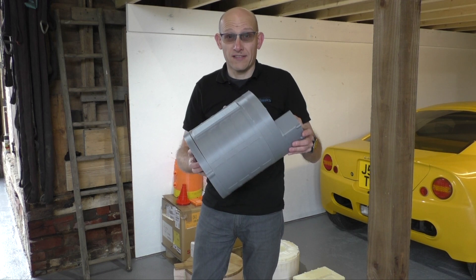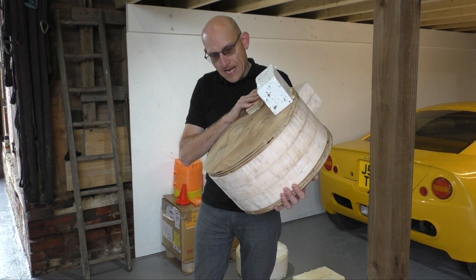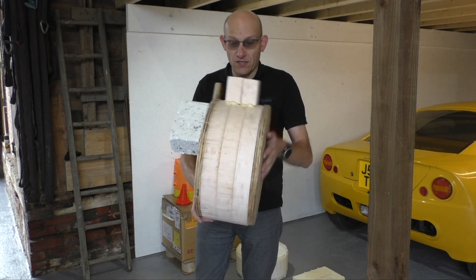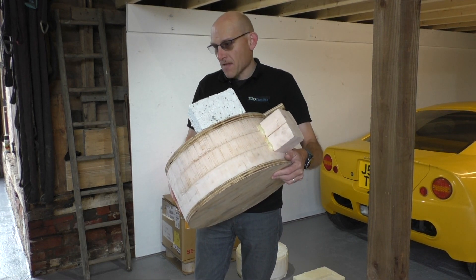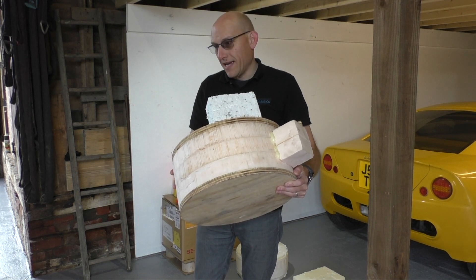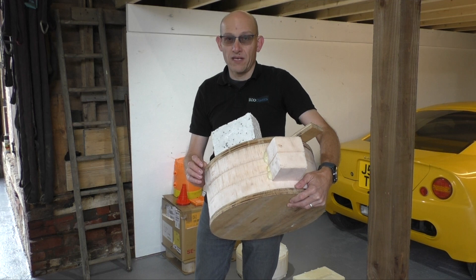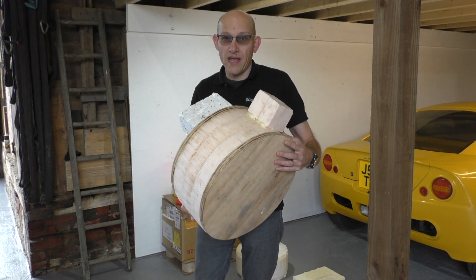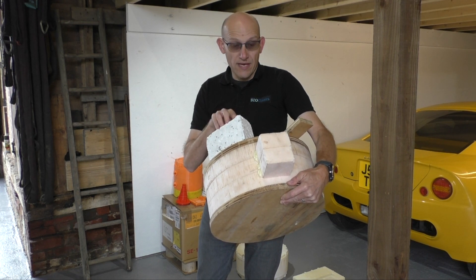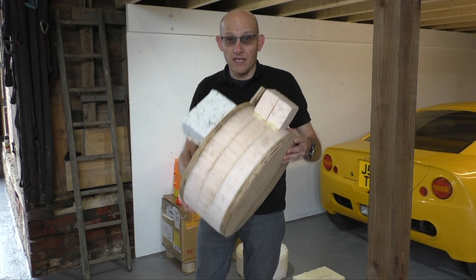So we moved to this. Again a very quick rapid prototype — we've tried to make sure we've got all the control and cooling parts on it. This is 660 Newton meters, a very different concept of motor. It's actually quite thin but quite large diameter. When you put it in the car on the centre line of the prop shaft, we have about 10mm either side. It also had some features we didn't like — cooling pipes on the top and an electrical control connection — which gave us a few packaging issues. But we really felt this was the right motor.